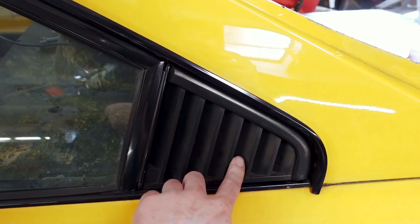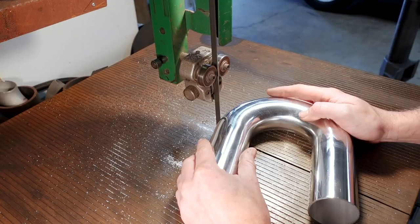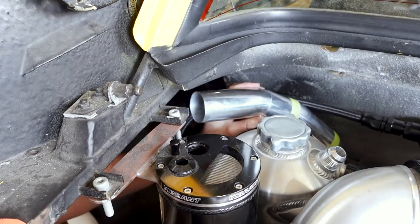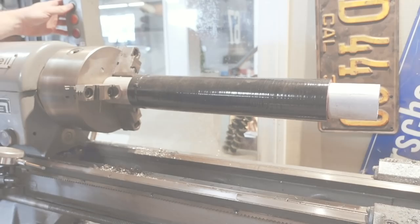Up next on the list is building a filler neck for the fuel cell. This is one of my favorite design aspects of the 308 — the filler neck is hidden behind this mesh, it opens up, and here you'd have the factory gas cap. I lost it, so we need to add a new cap and tube that goes from this hole down to the taped-up filler neck on the fuel tank. It should be a pretty simple project — hopefully just a couple of bends — so let's get out some two-inch aluminum tubing and start sticking some stuff together. This project was actually quite tough to document because the camera just won't fit into one of the most cramped areas of the entire build so far, but most of it just consists of cutting, fitting, cutting, and fitting, slowly trying to get the pipe to point exactly where you want it. Each end of the pipe has a specific location it needs to land and we've got a few obstacles to dodge on the way, but eventually I wound up with something that gets us pretty much all the way there.